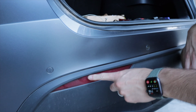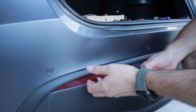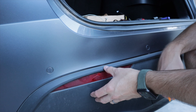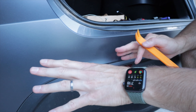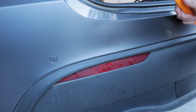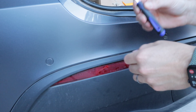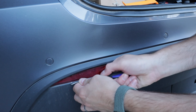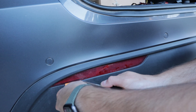First things first, we're going to remove this light, and it's really not very difficult. They show in their directions to wrap this in electrical tape so you don't damage anything, but I don't think that's really necessary because this is into plastic. The Model 3 goes where there's paint, and that's where you would want to wrap it — this is just into plastic, so it shouldn't be too big of a deal. The reason I love this product is because I backed into a tree off-road, slid in some clay, and damaged my tailgate and also cracked this light. So this is going to be perfect — a replacement plus it adds functionality. We're going to start with this pry tool and try to get in there. There's not much room, but I like this little hook thing. I'm going to get right in there on the back half and pull.